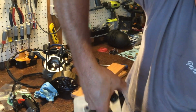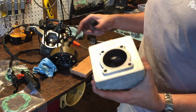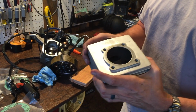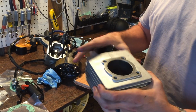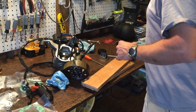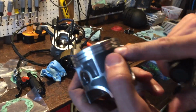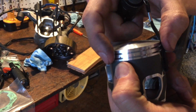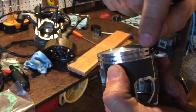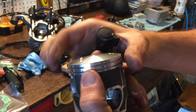I'm going to lube everything up in here. I'm going to lube the piston up when it's all back together. And I will compress the rings, and then I will have somebody slowly wiggle the jug back down, making sure that the rings are sitting on the pins. So there are two little pins. There's a pin right there, and there's a pin right there. So your rings come together, and the ends must meet at that pin. So you have to compress the rings, and you can wiggle down.